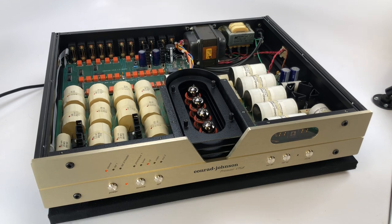By line stage, it means that it does not have a phono section. It has a phono input, meaning you can utilize an external phono preamp, but you would need a secondary box in order to run a turntable with this preamp. So you'll see in the front it does have a phono-labeled input, but that's a line-level input — you'll need a secondary phono section for this.